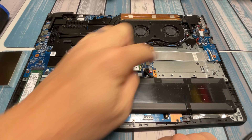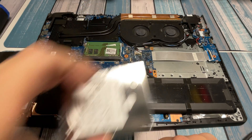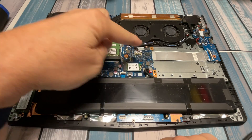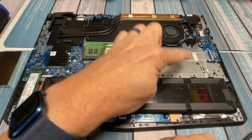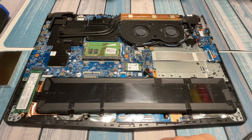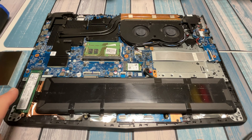There's a space over here that could fit a second hard drive, like a 2.5-inch drive, but on this particular model there's no mounting hardware and no SATA cable, so that's no good for us. And then lastly, we've got the NVMe drive right here — nice and easy to get to. To change this out or upgrade it, it's simply held with one screw.